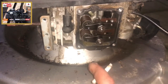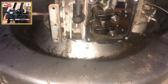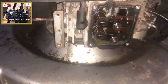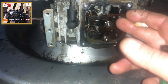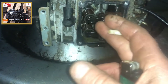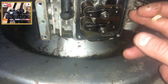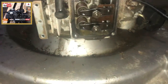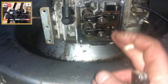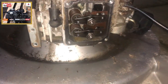The exhaust valve here was also stuck, so I had to free that up. Obviously if the valves' clearance isn't as it should be, and the stems aren't in situ sitting on the rocker arms, the machine's not going to fire. All I've done is get the valve stems back in situ in the recessed part at the back of the block — intake and exhaust — and freed up the exhaust valve.